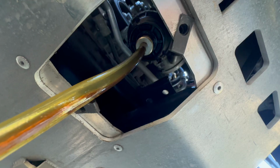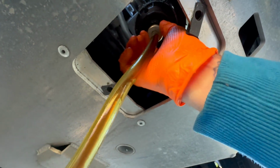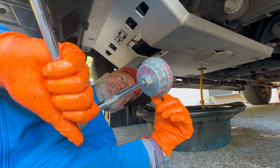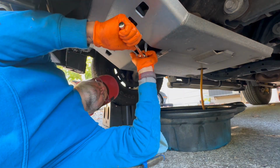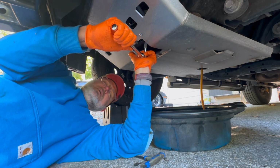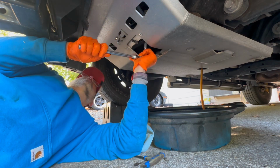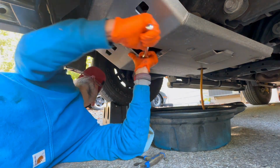Links for those two things are in the description, and a more full demonstration of their use in our previous 4Runner oil change video. After almost 90,000 miles of use, this black plastic oil filter housing on the front of the engine that we're draining has worn out, and it's time to replace it. Now, with the appropriate oil filter housing socket, we take out the old plastic oil filter housing, and it's been putting up more and more resistance each time as the plastic becomes deteriorated and has swollen with all the different heating cycles that this engine has been through. You can tell this thing's putting up a fight. I'm having to strain a little bit more than I should to screw it out.